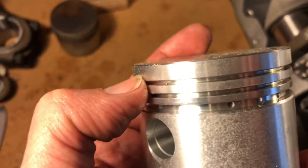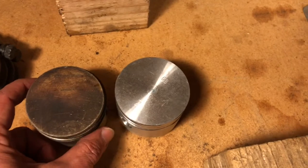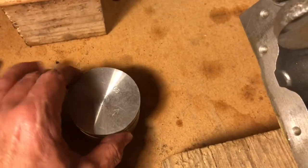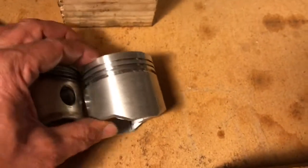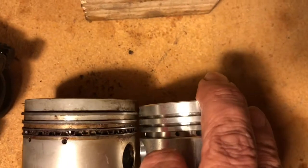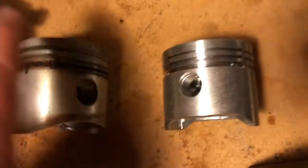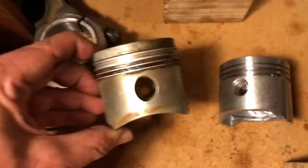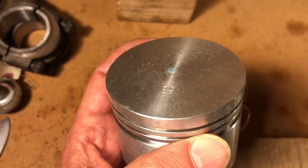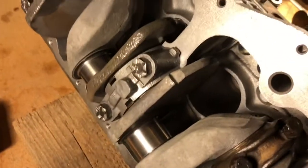Here's the 1098 piston — you don't have a lot between the upper ring and the top surface, and you do not want to expose the compression ring to the bore in an area where you've cut a notch. You can see the relative sizes here: this is a 40-over 998 or 1098-sized piston next to a standard 998. If you put the pin holes together, you see how much shorter the 1098 piston is due to the higher pin height, relative to the beer-can-shaped 998 unit.